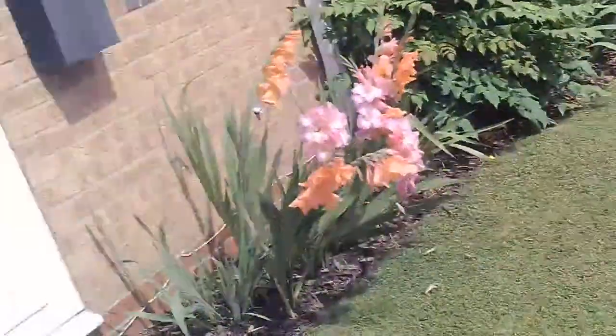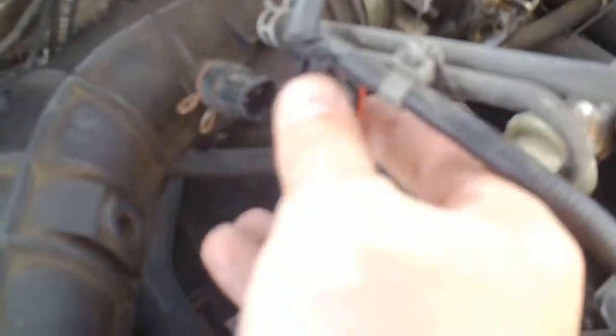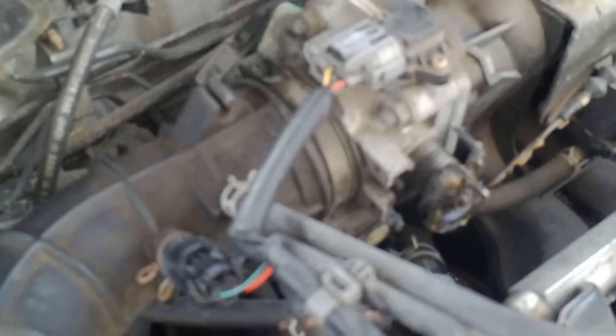I know it's the air intake sensor — let's go out to the engine and plug it back in. There it is. Plug it back in. It's a two-wire setup — you'll have a ground and a signal wire with a five-volt reference. One couple of ways of testing: the way I test the sensor is by taking the intake off and putting warm air through it, just to see if there are resistance changes from high to low. Then you're going to look for an open circuit and various things like that.